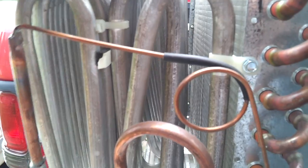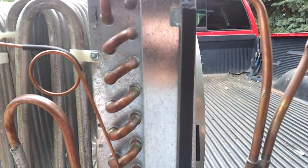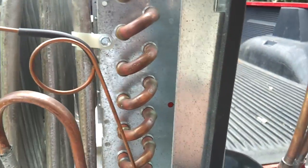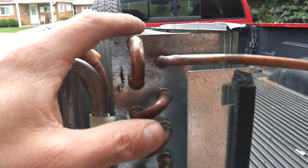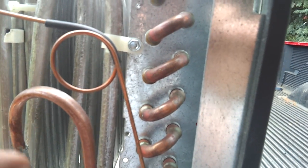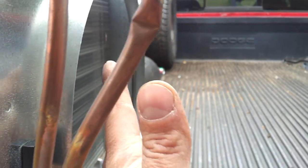In the case of a window air conditioner, the two fans are connected on the same motor. In the case of a dehumidifier, you're not really going for the cooling or heating action — though most of the time they do end up blowing heat because it generates more heat than cool. You only have one fan, which blows air over both units: it pulls the damp room air over the evaporator and then blows the slightly cooled air over the condenser.